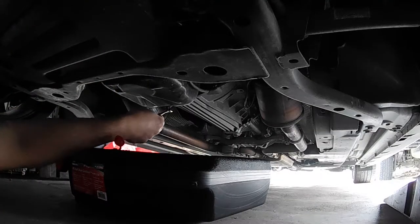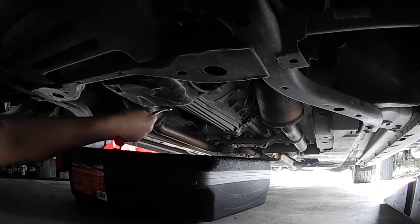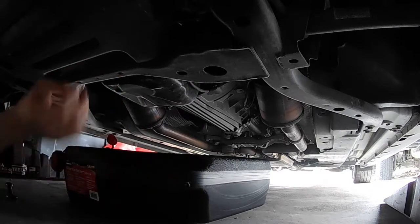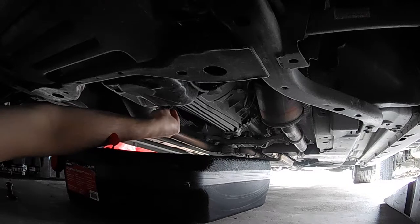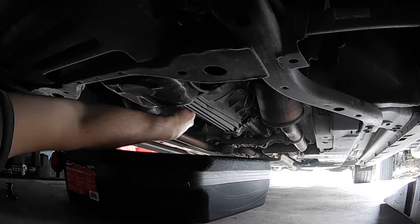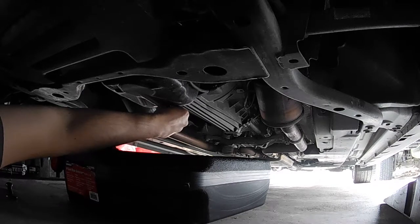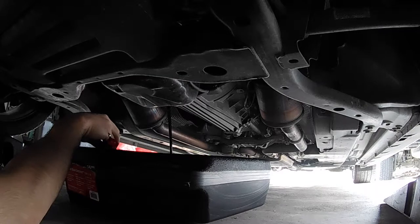Get in here and start loosening it. I loosened it a little bit before I started the video. Get your oil pan in place — it's going to flow a little bit. Just start loosening it by hand. Careful not to drop the plug in there — you're going to want to pull it away. If you drop it in, worst case you've got to fish it out, and I don't want to have to do that. So let that drain just like that.